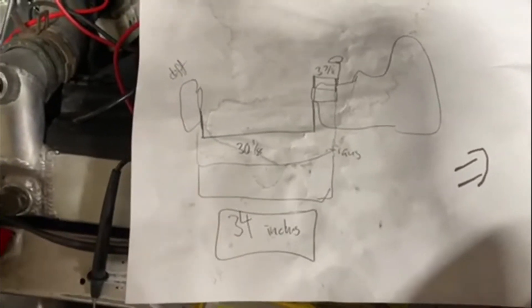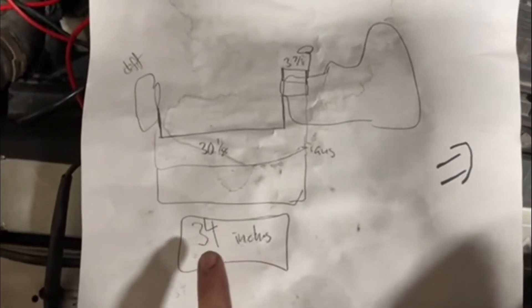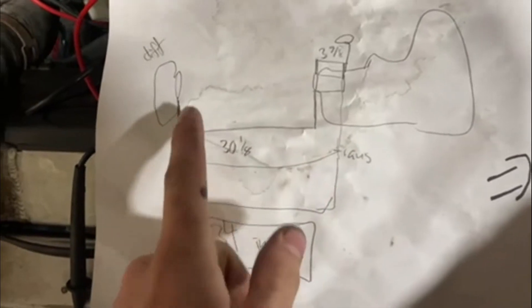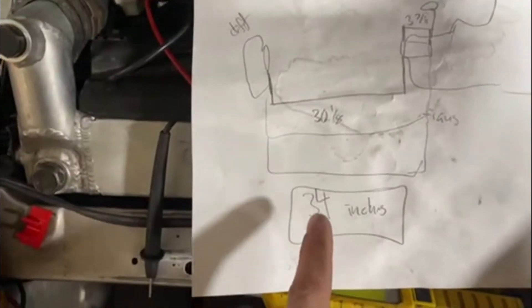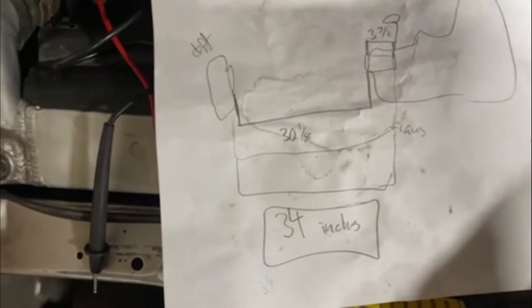I didn't film me bolting it back up because I wanted to get it done, so I just bolted her back in. To anyone that's interested — at least with the position I have the engine in — this is my driveshaft. It is exactly 34 inches, and I went and got a custom one and she bolts right up. 30 and 1/8 inches from the flange of the diff to the end of the shaft, and then the shaft goes in 3 and 7/8 inches — add that together. Total length from end to end was 34 inches exactly, and she bolted in and it works great.